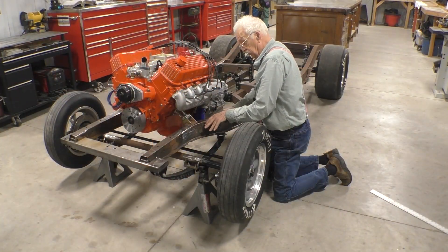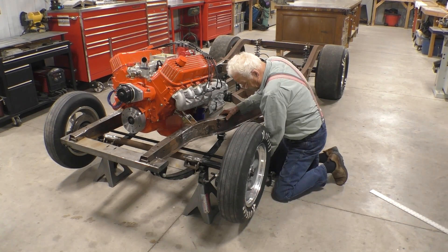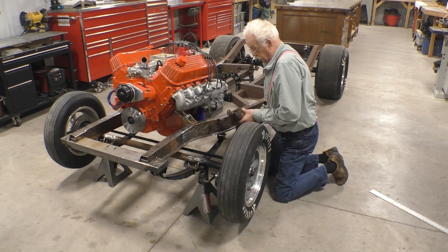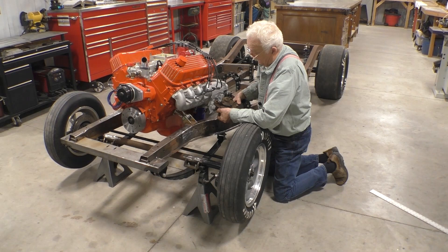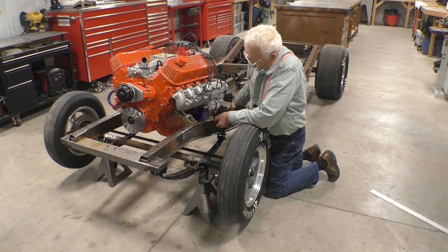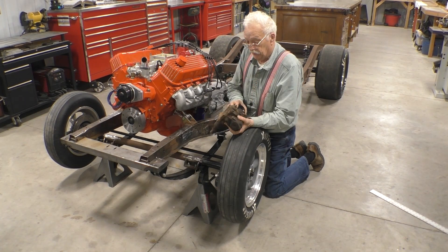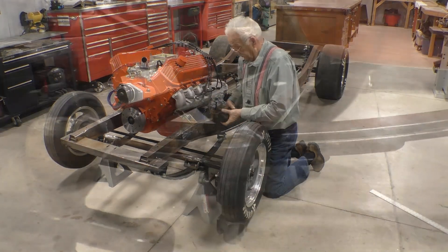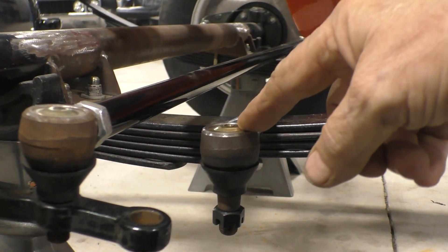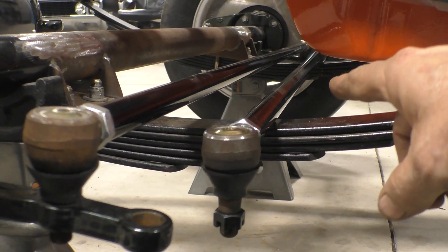So I have to be in back of the axle. What I've found is that the manual steering box out of a 1965 C10 pickup truck looks like it will bolt to the frame once we remove these brackets. When you turn the steering wheel, the gear shaft turns in the right direction to turn the wheels in the right direction. This is the drag link — it runs from the pitman arm to the passenger side steering arm.